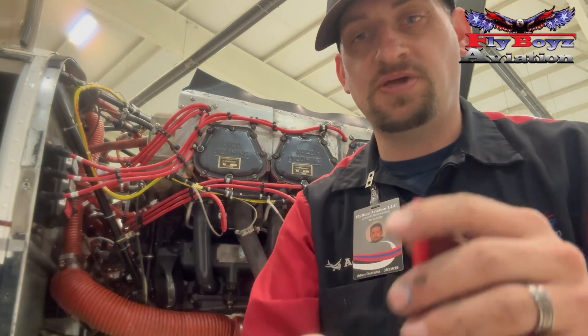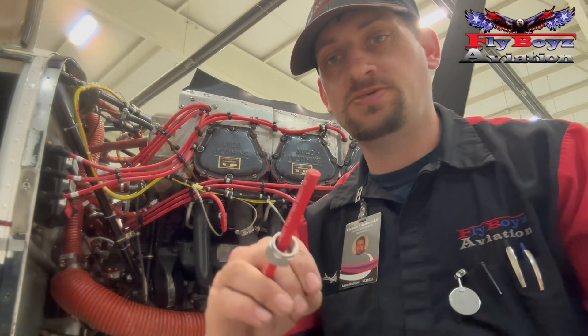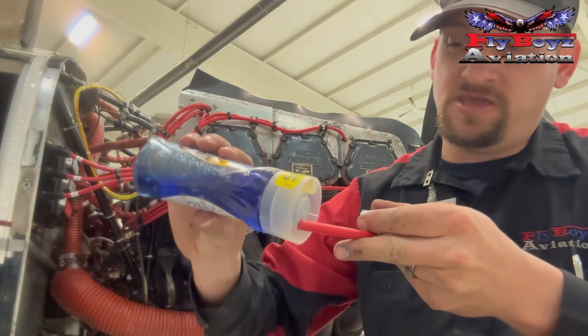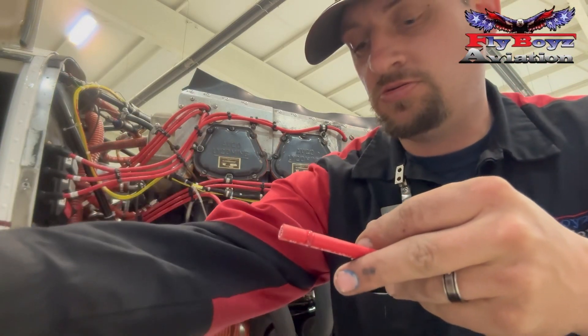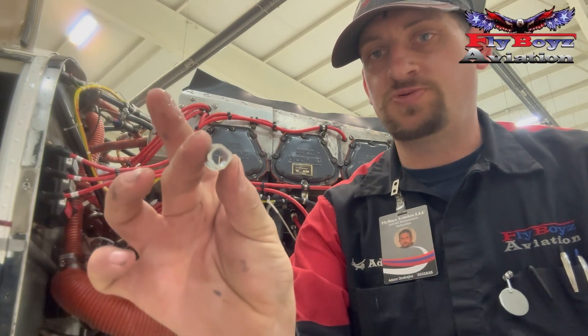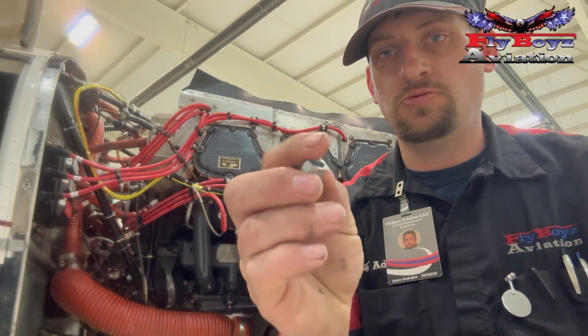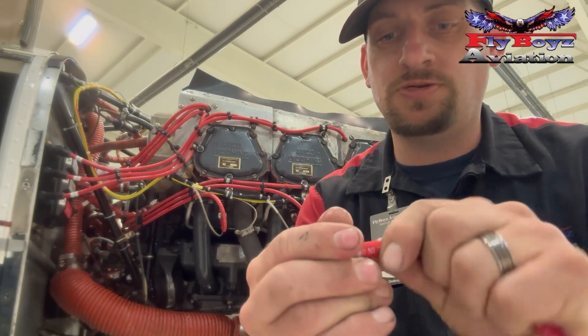So if we cut this back, or in this case spin it around — this is how it would look after you cut it and get it to size. You're going to slide your barrel nut or ferrule on there. Then we're going to take a little bit of dish soap — this is one of my handy dandy quick easy tricks. Put a little bit of dish soap on the end and lube it up nice and good. With the square end going out of the nut, we're just ever so slightly going to work it onto the end of the lead. With everything soaked up, it will push through nice and easy.